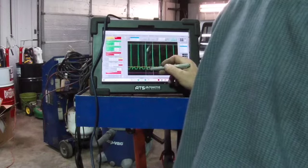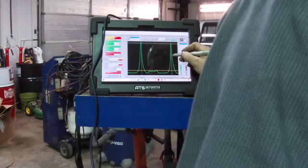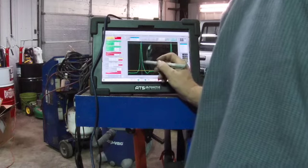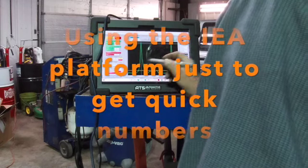Window. We can get our cursor set better. I don't see much sense in checking the other cylinder because I know it's not moving. And again, it may actually be moving, but the computer sees the voltage and sets the code as soon as it's not. I'm not going to waste my time because we're chasing a code and wanting the correction for it. And right now the correction looks to be an electrical problem.